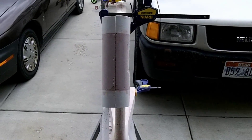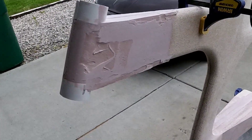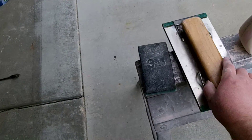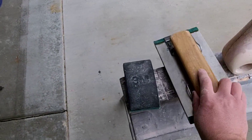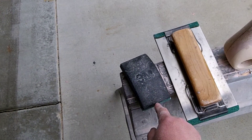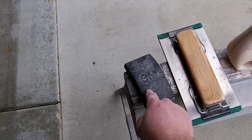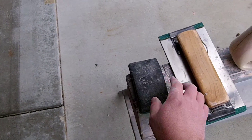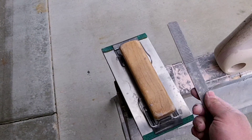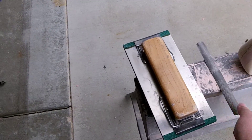You'll see it in a little bit because I'm going to work on that now. Just to give you an idea, these are the tools that I'm using — just a sanding block like this, a small 3M rubber one. Sometimes I'll put a piece of sandpaper on the backside here. You can see I've cut these 3M letters off so it's a nice rounded area. And just a file — this works really good for getting the big chunks of Bondo off, and then I'll transition to one of these other ones.